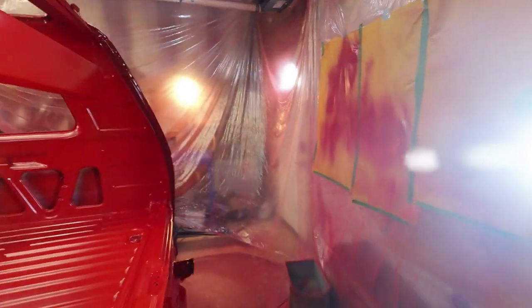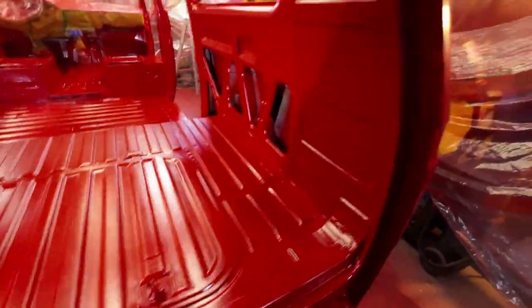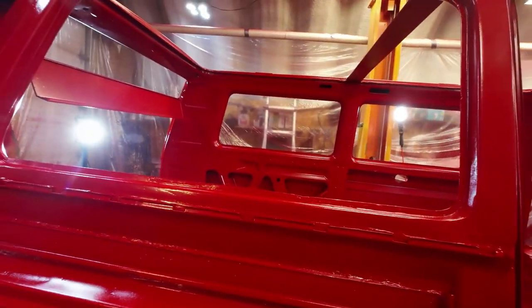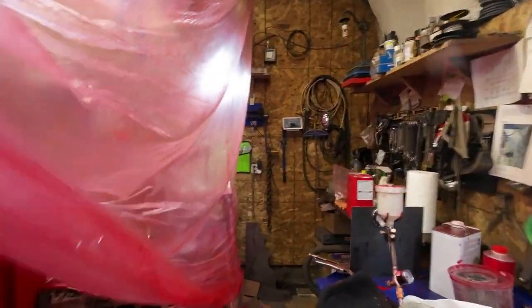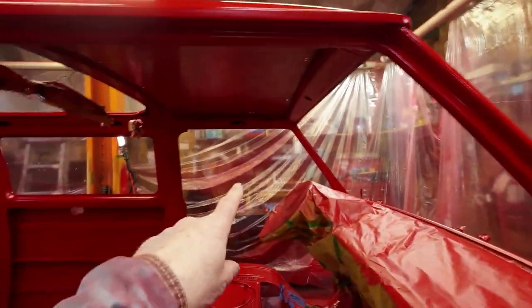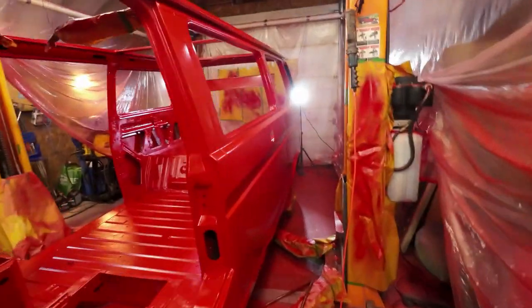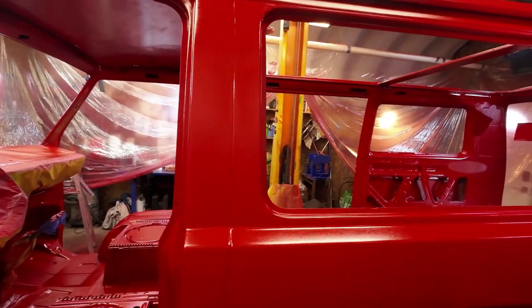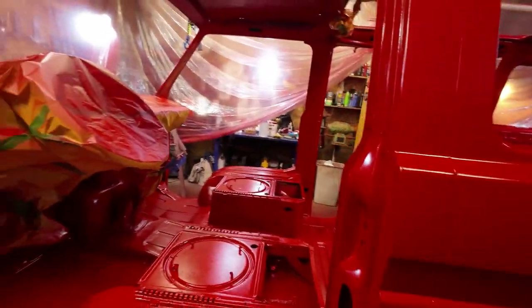Cool. Well, I'll just see what happens here now. It's time to do clear coat. Now a couple of things I learned here. I learned something yesterday. I had trouble when I was putting on the last coat. The gun started clogging up over on the outside over here, and that's where it came out with the worst orange peel, just this panel right here, which isn't that bad because I stopped painting when the gun was clogging up.